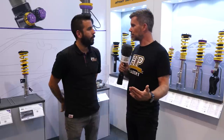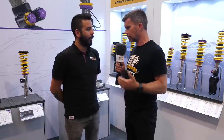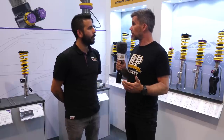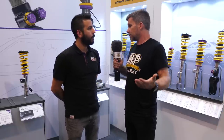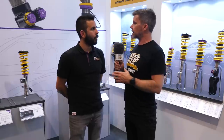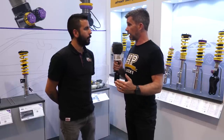It's a common misconception that harder is better in terms of spring rates as well, but the wheels still have to be contacting the track to do their job. One tip for going to a track day is to be methodical about your testing. There's no point randomly adjusting front and rear — if you've got 20 clicks of adjustment, maybe make the first change 10 clicks, or go full soft to full hard, to understand that range, then start making smaller adjustments. The really important thing is methodical adjustments — go to the track with a plan, write down your findings, and that's a great way to start understanding how those changes make the car respond, so you can fine tune and find your happy place.